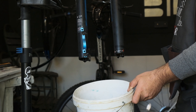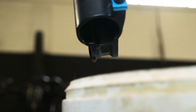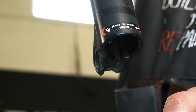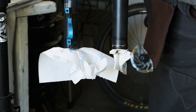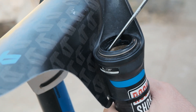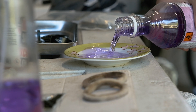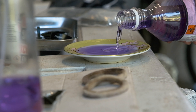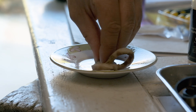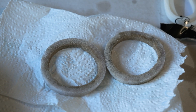Prepare a bucket for the oil — it should leak down from the lower. There are 5ml of oil in each leg so do not expect more than 5ml. Most of this oil will remain on the inside of the lower, so you will need to clean it with isopropyl alcohol and a rag. First, remove the foam ring from the inner part of the rubber seals. These are pretty inexpensive parts, so if they are dirty — meaning darker gray — it's recommended to replace them completely.